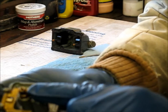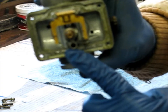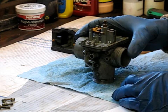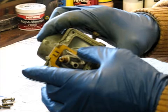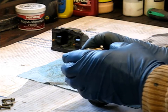You can see this jet right here, and this will have to pull out. The jet that I'm concerned about is down in this hole right there. That is your idle jet — that's the one that has to come out. It needs a long, skinny screwdriver to get that out. I call these the wrong names because I really don't know how to call them the right name.